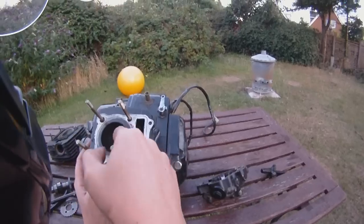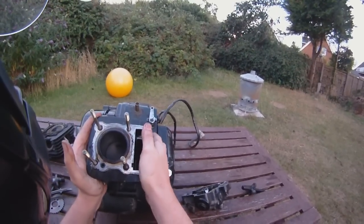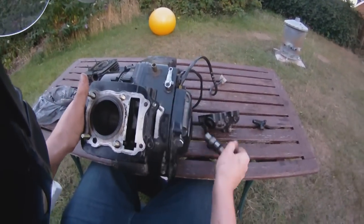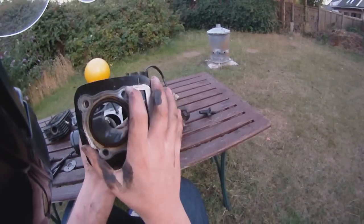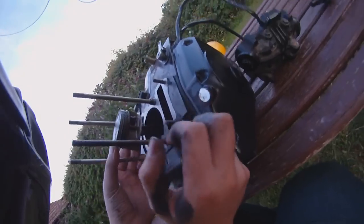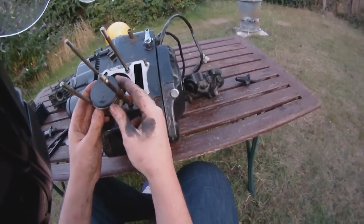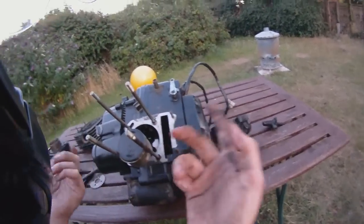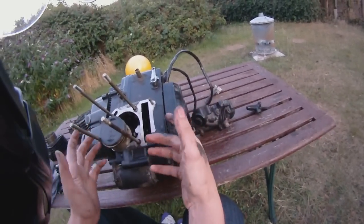Carrying on down, this is the groove that the cam chain's in. We've got the piston down there. I can't get my piston back fully into the barrel because the rings have expanded a bit. The next bit is the head itself, which is basically the cylinder that everything goes on in. Mine was in good nick, although there may have been a bit of blow-by — the side of the piston is a little bit scorched and there are some marks to indicate it might have been going round the piston rings. There are dents in the top of the piston that correspond with the valves. So basically it's the piston going up and down, getting fuelled by the valves, which is run by the cam chain — that's sort of one side keeping the engine running.